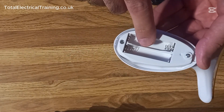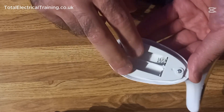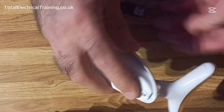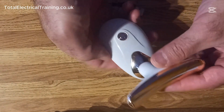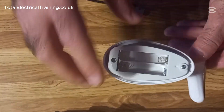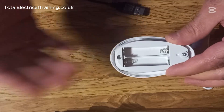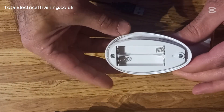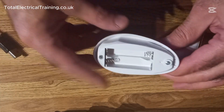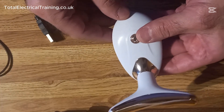There are going to be people who say this will burn the device — it won't. This device runs on three volts and USB gives five volts. For something like this facial massager, it will just run faster. The motors inside are designed to work from two volts to six volts, so they won't burn — they'll just run faster.